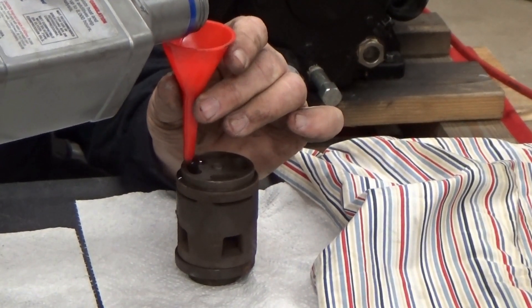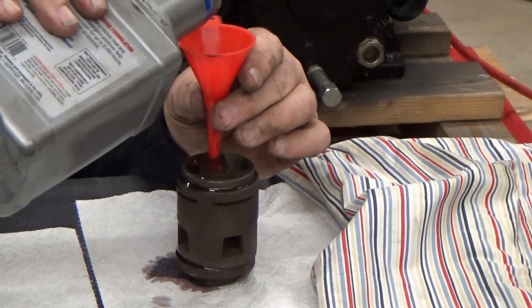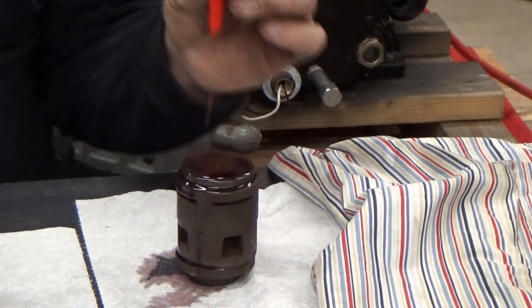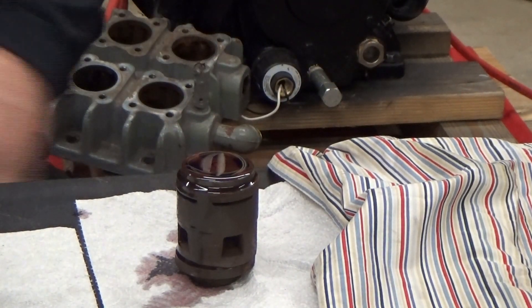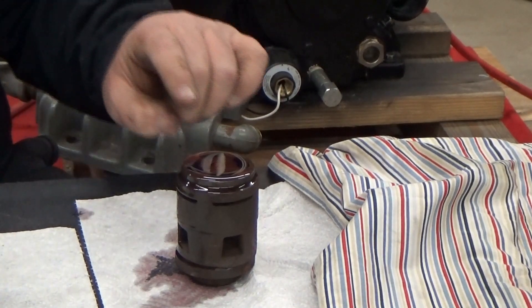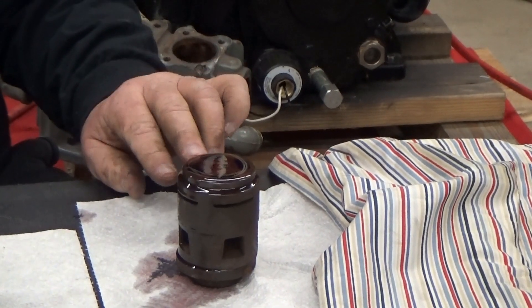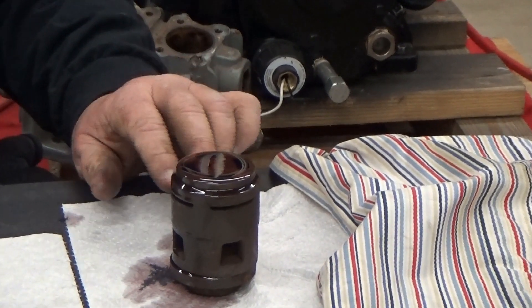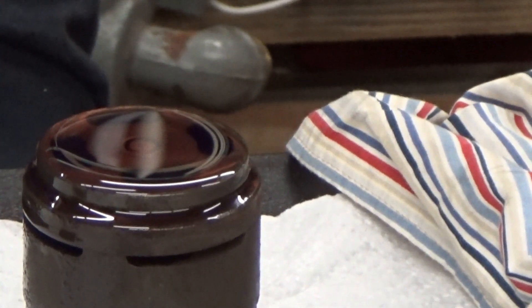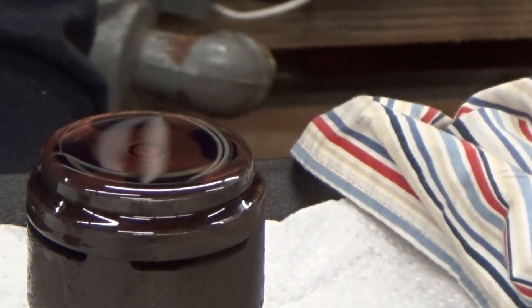We just want to put enough in. You can see the fuel sitting in the cavity. This is an exhaust valve — you have to check the exhaust valve upside down. You can see the fuel sitting in the cavity and we're going to do a time-elapsed thing. We're going to watch it for 30 seconds, and if it doesn't drain down, that's a good valve.